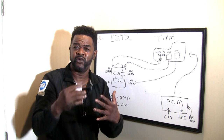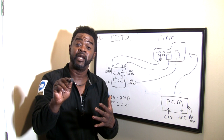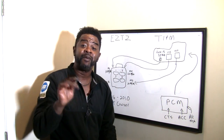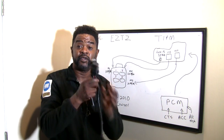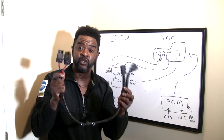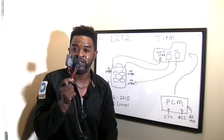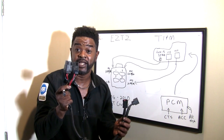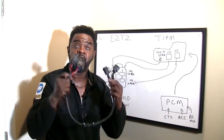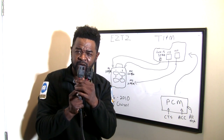You still need a way to turn fans on and off. We still utilize a high speed fan relay and a low speed fan relay, but they are housed inside the module — it's not a physical relay. Never mind the relays you see on the actual fan, because we're talking about the 06 through 10 and they utilize a wire harness on the fan module. These are not your low speed and high speed fan relay. These are simply switch relays. They just convert low speed current to high speed current and operate the fan. These never go bad — do not replace these thinking they're going to make your fan work.